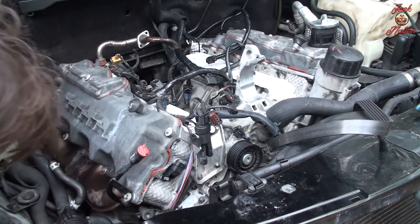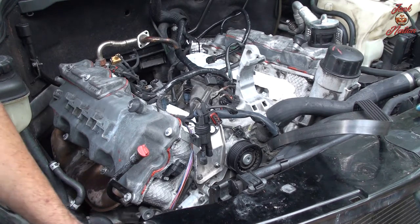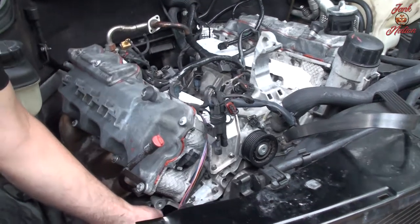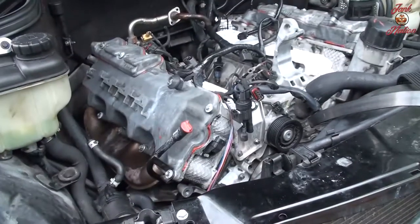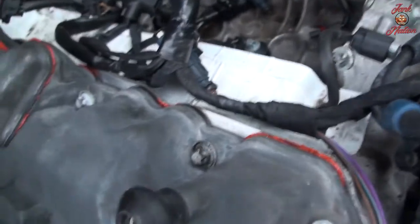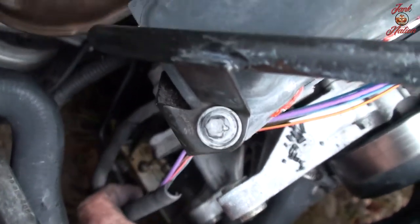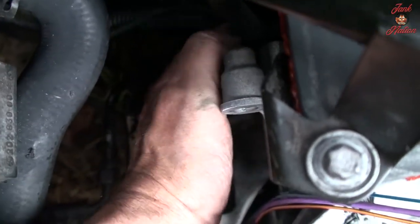Like it is part of the wiring that feeds into the bottom of the engine. Also, that secondary lead, or whatever the smaller wire is on the alternator, the eyelet that I broke right there. So it swoops down around here. Let me take the camera off. Comes from here, swoops down around, runs in between the alternator bracket and the alternator, then loops back, then goes underneath down here, and then it's wire tied into here, and splits out of here.